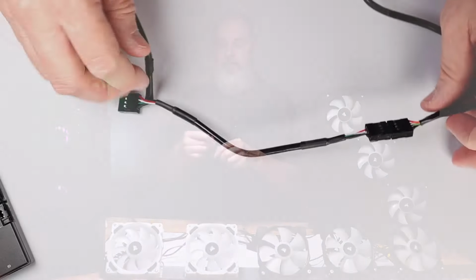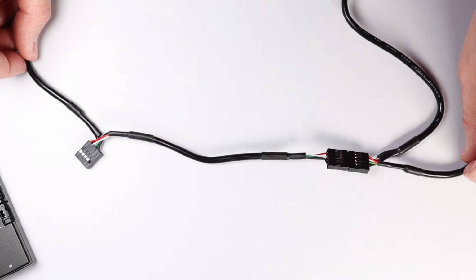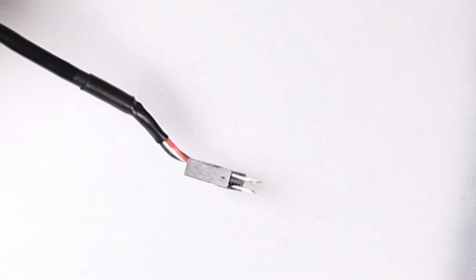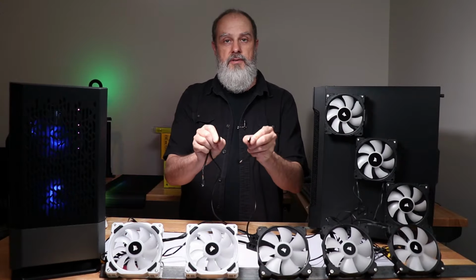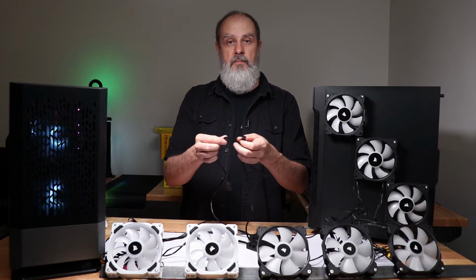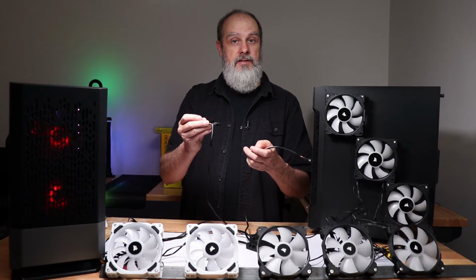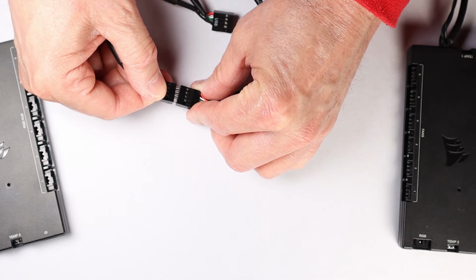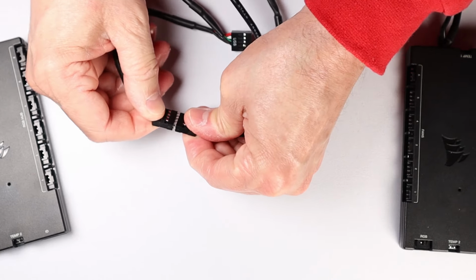Now, the Core XT does have this little pigtail expansion port on it, but only a single set of pins is connected. So this will be one of the first caveats you should be aware of using this device. If you connect each of these cables into a motherboard header, utilizing 2, it works just fine that way. You can animate over it. You can also connect your first one into your motherboard header and then the second one on the pigtail header. That does work just fine.